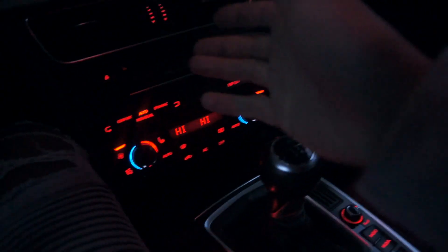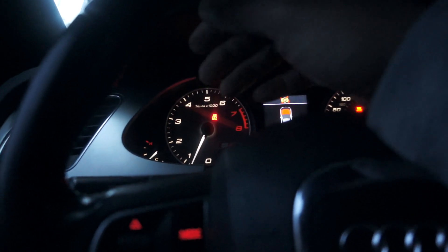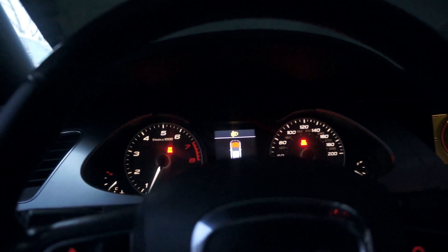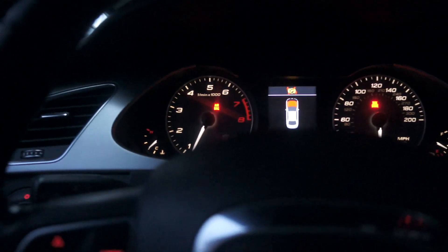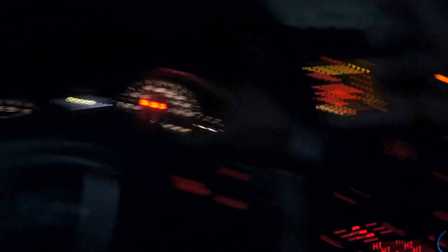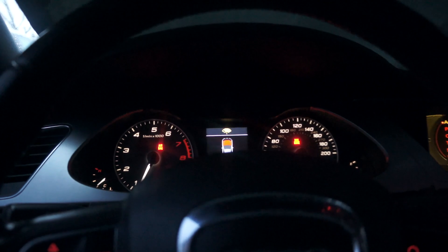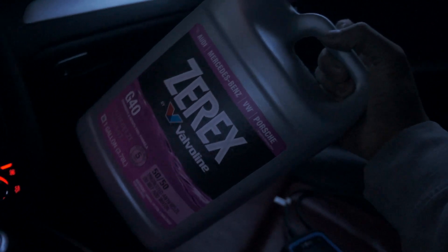I had been doing the 2,000 RPM revving quite a bit, with the heater set to hot. After holding the RPMs, I'd go outside and crack the bleed screws on top of the supercharger, and I actually got to the point where it was just pure coolant coming out. So the system would eventually burp with everything running. It did burp a few times and drink quite a bit of coolant — I had to refill it. I used about two and a half of these coolant bottles, so we have less than half of one left. Wouldn't be surprised if we need a little bit more.